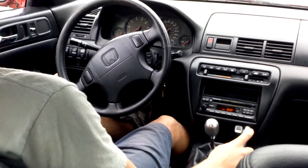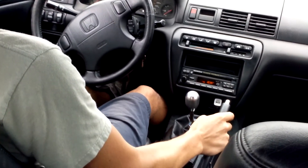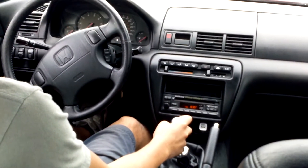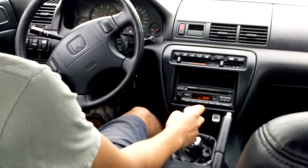When you're parked, you want to have the e-brake up, at least if you're in neutral. Or you could be in gear. If you're on a hill, you want to be in both.